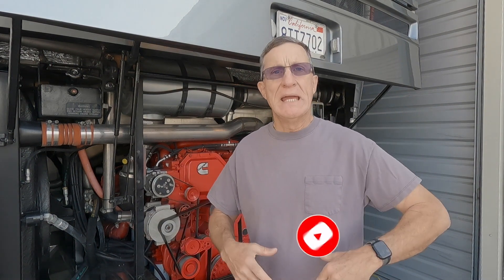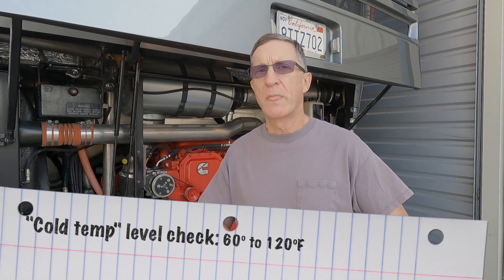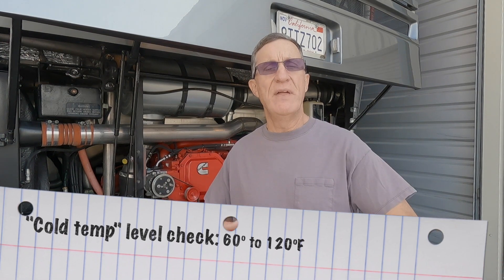What I'm going to do first is called a cold check, and that's to assure that you're not going to take your motorhome out and start running it when your transmission levels are either too high or too low. Both can damage your transmission when you start driving any distance. The first thing you're going to do is come up to your motorhome and check what's called a cold level — that's generally between 60 and 120 degrees. Right now it's a nice warm day, so I just need to do a cold start and check it, then we'll let it warm up.